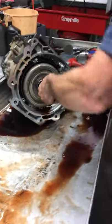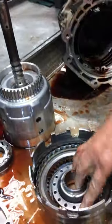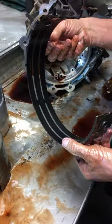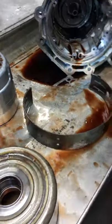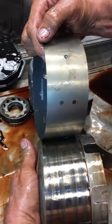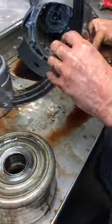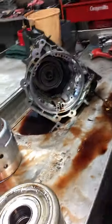What I'm pulling out now is the second gear and overdrive drum, which has your reverse clutch on the inside of it. This here is the band I was talking about — your second gear and overdrive band. GM's been using it for a long time and I don't know why they haven't upgraded it, because the drum is wider than the band. When we go back with them, we always go back with an extra wide band which covers basically the whole drum. The durability and longevity of doing this just makes the transmission so much more superior. I don't know why GM hasn't done this a long time ago — I guess they just care about their 36,000-mile warranty.